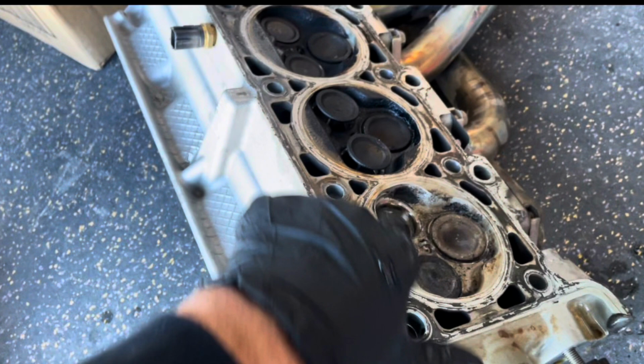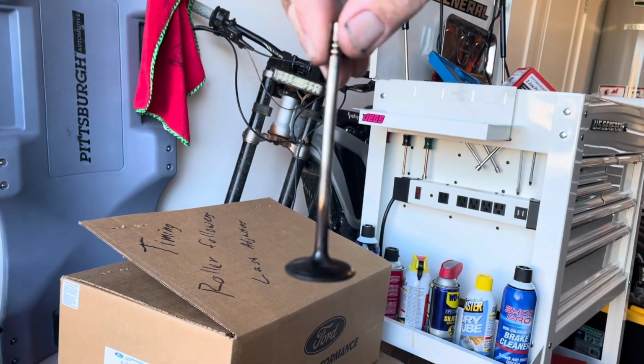I appreciate it. And so if we look at the head, you can see that cylinder where my hand's touching, that cylinder is the part where it had all the moisture and the condensation and the gunk buildup. And sometimes when you have like a blown head gasket or something, it'll steam clean that piston as the engine's running. And so to me, that's the explanation to why these combustion chambers are different, how some of them are dirty and one of them's kind of cleaned up, and the cylinders, why they look that way too. Because it must have had a lot of moisture in there, cleaning it up by pressure washing it, basically, and the extreme heat and pressure of the cylinder. So just really weird to see.